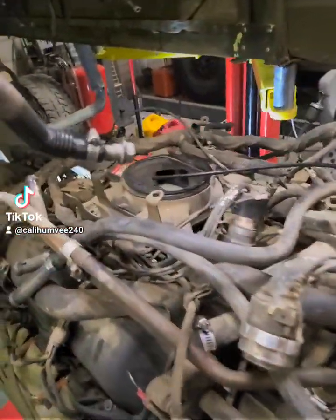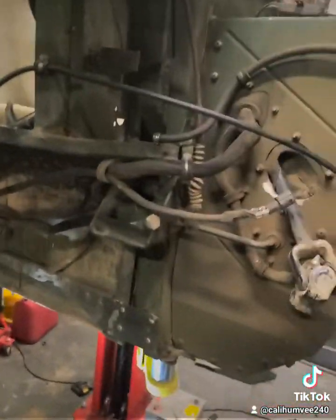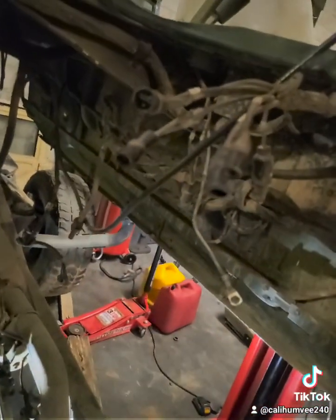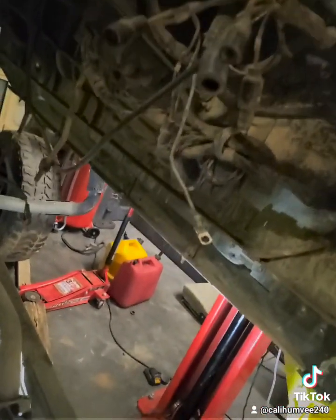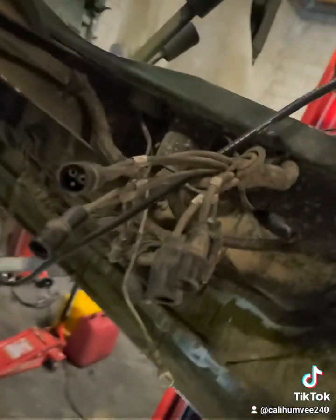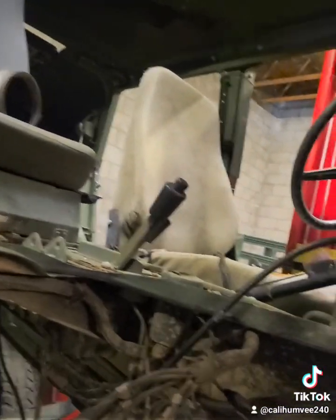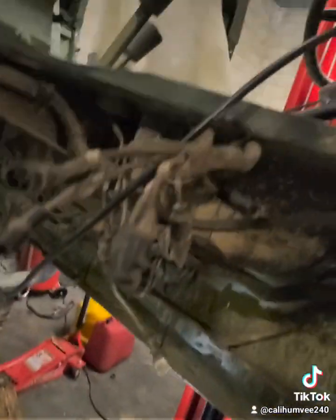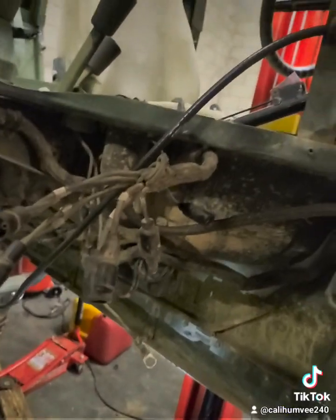Also, there are three lines that belong to the body harness that hook up to the transmission — that's one, two, three. Don't forget your linkage either. And the main connection that hooks all the power from the engine harness to the body harness — you'll see those cables if you open up the hood on the inside of the cab. That joint connects both harnesses — the body one and the engine one — and you need to unhook that.